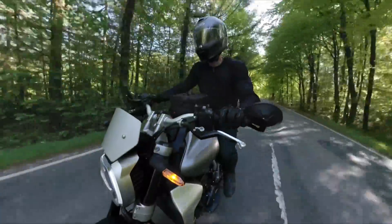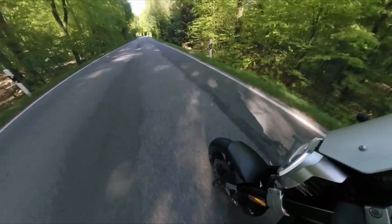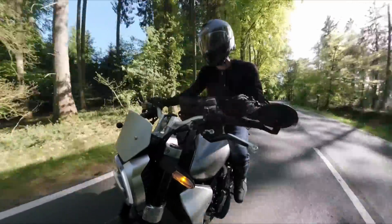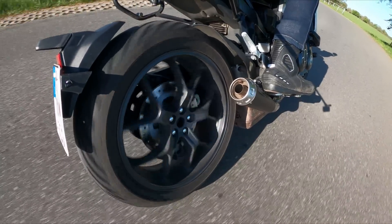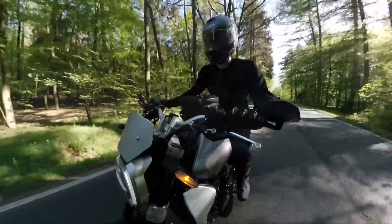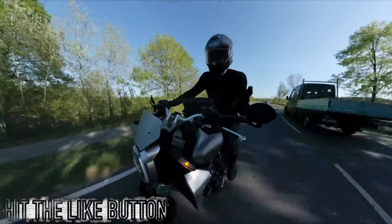The second mechanism is mechanical grip — things like the tread pattern, profile of the tyre, the depth of the profile, the flexibility of the sidewalls, and how the tyre disperses water to make contact with the road and get that chemical grip into action. The Spirit STs do this with a really aggressive wet-weather-looking tread pattern. The rear in particular is very reminiscent of a wet race tyre — really deep grooves and lots of them. As well as this, the tyres also have 3D sipes with teeth in them.